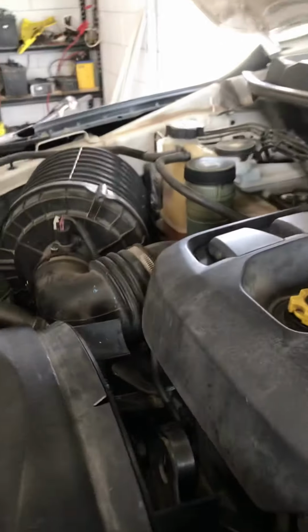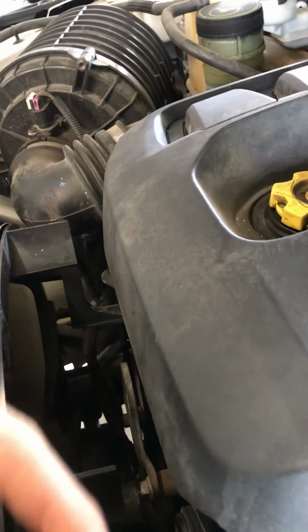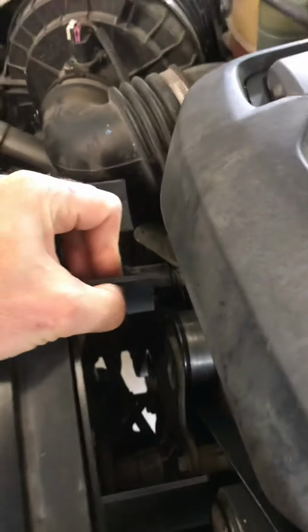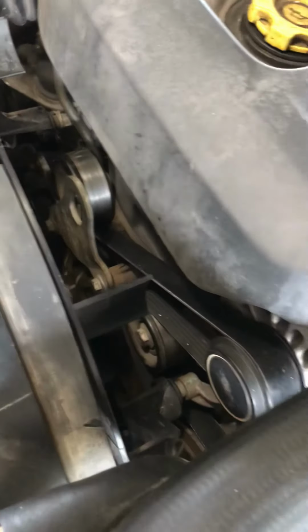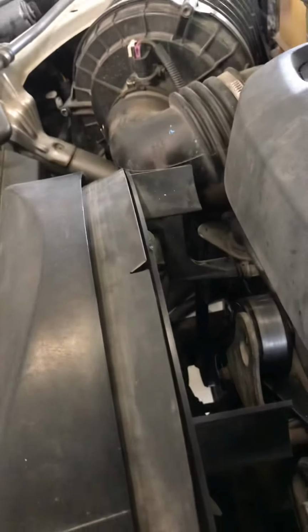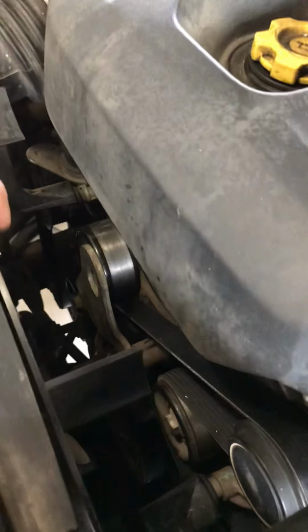Now, there's one real pro tip, I guess, is these little plastic tabs here. Cut one of them off. It's going to scratch your arm as you try and reach in and feed the serpentine belt through the pulleys. Just remove it. It's not worth the stress. Not the stress, the pain. Seems like a torture mechanism when your arm's down there trying to grab your ratchet back out when it's fallen. So that'll make life a little bit easier.